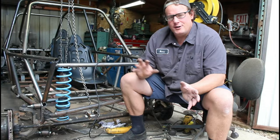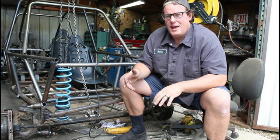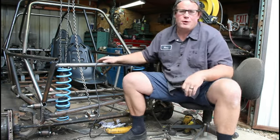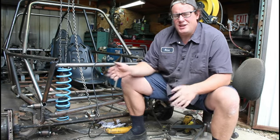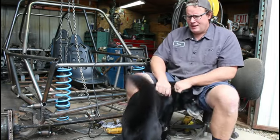As it sits right now, the rear suspension has about 12 inches of travel, and it moves about 1/4 inch toe in from top to bottom. And the setup's really nice because I can use Type 2 CVs, which is what's factory on that O2J. You can buy them on Apple Tree Auto. They come in inch increments, so I can buy a separate set of axles and set it up. Just run Type 2s.